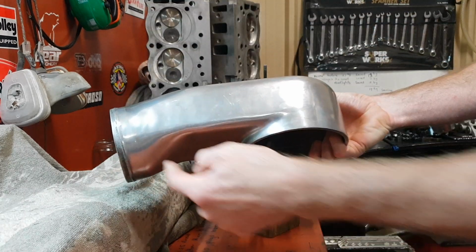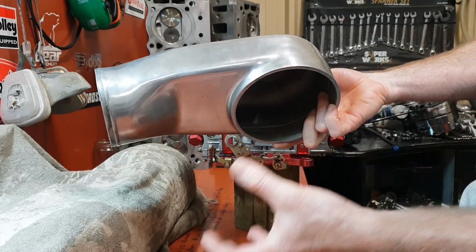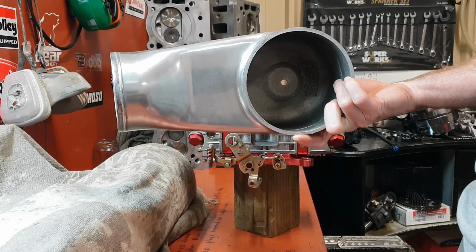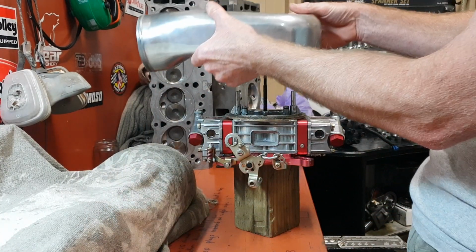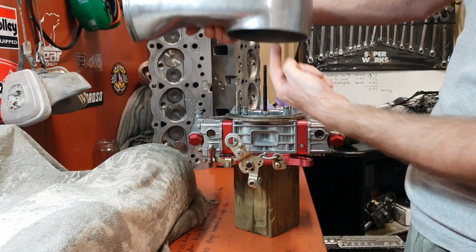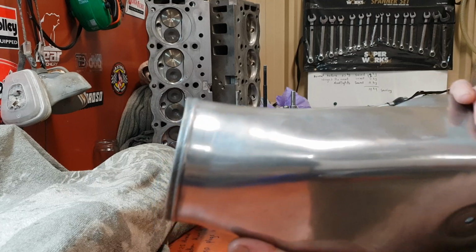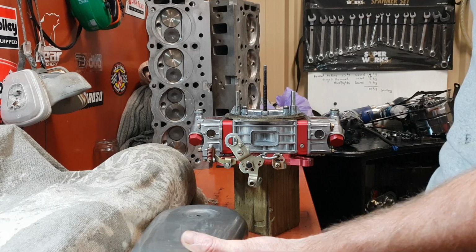I wonder if the air is coming up flat out, hitting this back edge there and spewing back and disrupting it all, really turbulent in there and horrible. And I reckon that's half the trouble, you know. Just not a good design. So, like I said, if we lift it, create some plenum, fix up inside here and get a nicer radius happening, I think that's going to really help big time. Well, I'm definitely not going to go backwards with it. That's a fantastic comment, Jez. You've done really well there, mate.